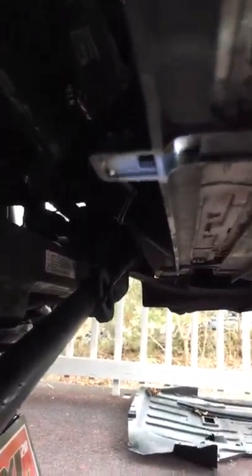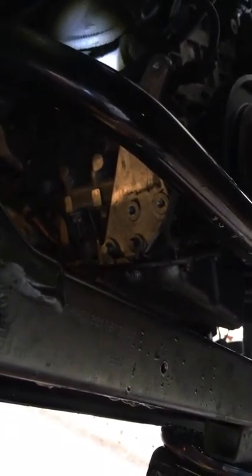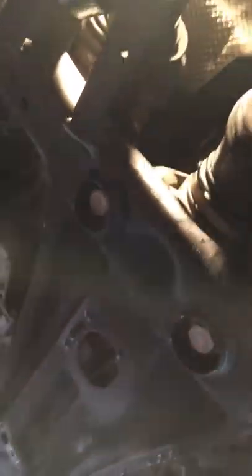You can see that oil cooler — there's that lip I was telling you about. You take those bolts out of the fan shroud and it just sets in here on these little holes, it's not hard to get out. But I ended up breaking the piece of plastic on that hole I showed you. The guy said just pull up on it and it'll come out — well I jerked on it and I'm lucky it didn't knock a hole in the radiator. I took the tire off and came in through the side, underneath the bottom. Whatever you gotta do, you're just gonna have to take your time.